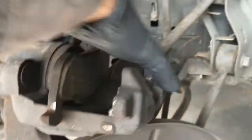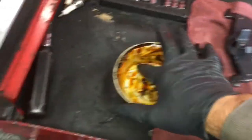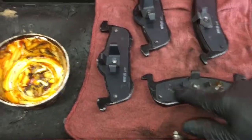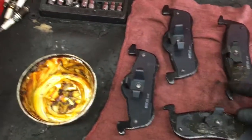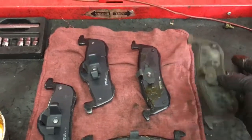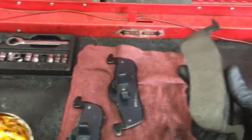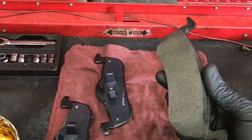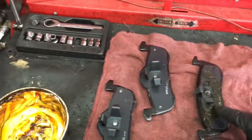Now go ahead and pop the old brake pad out of the piston. Now we need to do a little prep work on the new pads. What I've found over the years is that adding a little bit of brake caliper grease — a thin layer — applied to the back of the pad on the shim helps reduce squeaking and vibration. Also match up your old pads with the new pads to make sure you've got the right ones. Be careful not to get the grease on the front friction side, as that's known to actually cause squeaks. If you do get any on it, use brake cleaner or a little sandpaper to get it off.